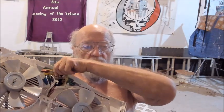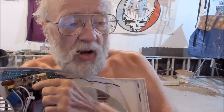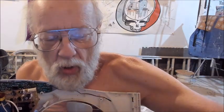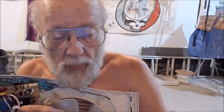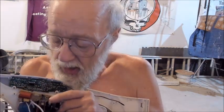This guy, you can't see it very well right here, but it has a metal lug on it. There you go, you can see that metal lug. This guy is taking in heavy voltage and chopping it in two. It's like it's chopping the highs or giving you only half of the 120 volt cycle. And it uses some of those, and by trickery, if you will, it reduces it down to 9 volts direct current. And part of any of those circuits are these black cans that you see here.